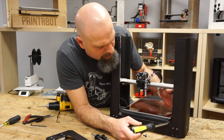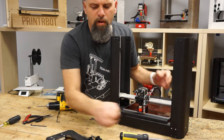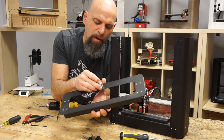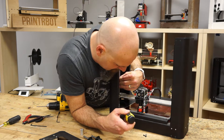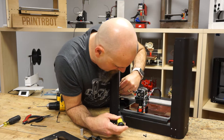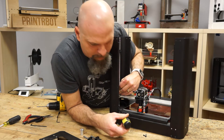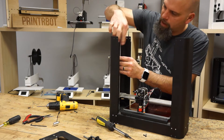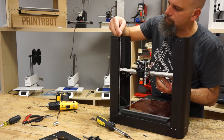I don't like my Z-coupler to sit right on top. I don't want any friction from it being pinched against the plate. So I'll raise it — not even a millimeter. Make sure your Z-coupler isn't resting on the bottom. Raise it up a little, tighten it down. Don't over-tighten this — you can strip out aluminum, make no mistake. I've got my — oh, this one's on upside down. Glad I noticed that because there's a recess hole there; you want that facing down. So let me do that again.